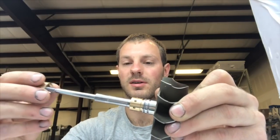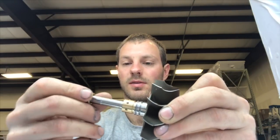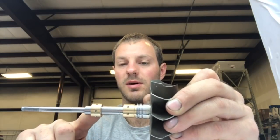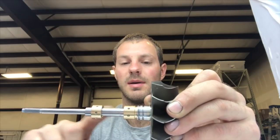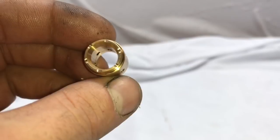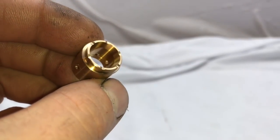With the Gen 1s, when they wanted to convert it over to journal bearing, they had special journal bearings made that would go onto the ball bearing shaft to make it work for a journal bearing turbo. The specs on these bearings are that the front one is a little bit tighter than the normal TO4E bearing, and the back one is staggered inside so it fits on both staggers.